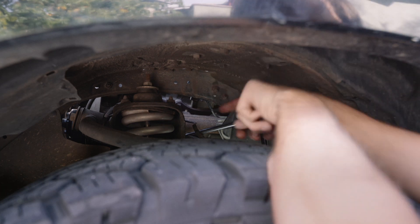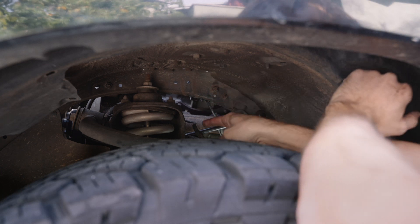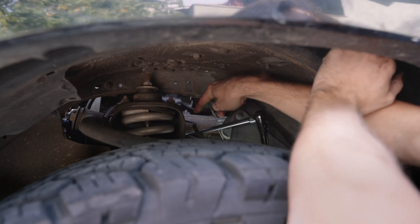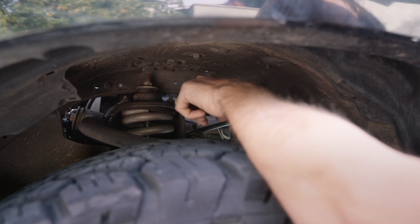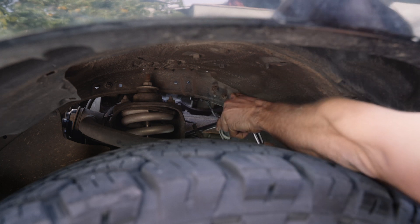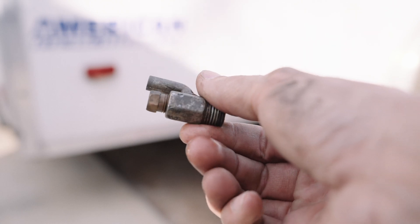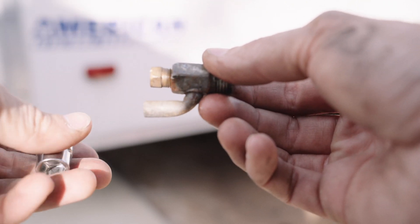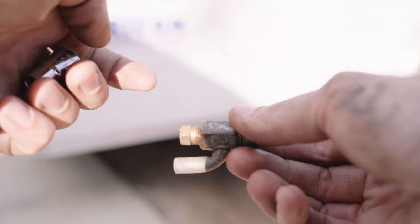This was pretty difficult to get my socket on there. It's a 14 millimeter deep socket that you want. I showed you where it was earlier, but it was so difficult getting it on there I wasn't filming. What I had to do is reach down from on top of the engine and get my hand down that socket before actually putting my ratchet on here. So I actually made a mistake — I did use the 14 millimeter socket and I pulled the whole thing off. What you actually want is a 10 millimeter socket just to unscrew the end. You don't want to unscrew the whole thing. With that all finished draining, you can go ahead and tighten it back up.